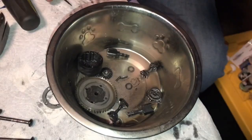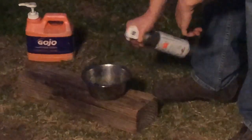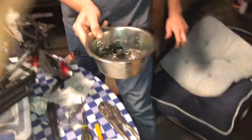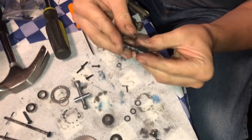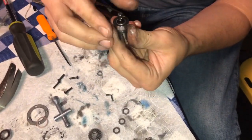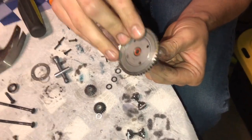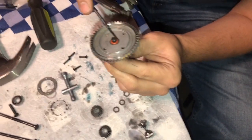Camera crash. This is a used vehicle so every time we're finding shims and stuff they're a surprise to us — and that's why they're surprised, because we don't know what happened. I'm going to assemble the first half of the diff. Got your cup, put a shim on, and then a bearing — I'm using Fast Eddy sealed bearings. Stick this on and just kind of wiggle it in place, kind of snaps down. Got your O-ring, make sure that's seated.